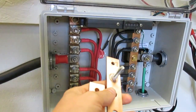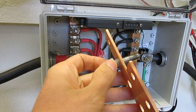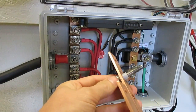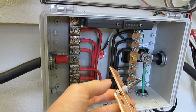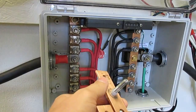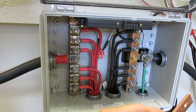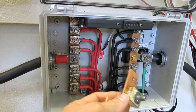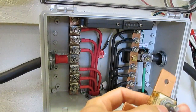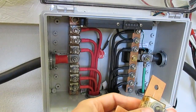What you are left with is a bolt that is sticking up. You will notice there is a nylon sleeve on the bottom of that bolt — that keeps the bolt insulated from the copper bus bar, so the bolt does not actually touch the bus bar at all. That allows the current to flow from the battery through the fuse down onto the bus bar. So that's how that works in case that was a little confusing.